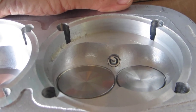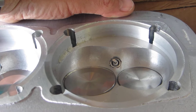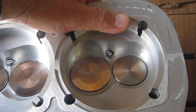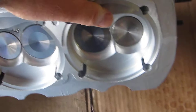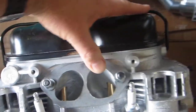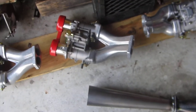The fly-cut should bring the combustion chambers to about 52cc. I'm going to measure that with a burette — you fill it with liquid, drip it into the chamber, and it reads off the cc's. That also explains why the IDF manifold was welded: so it could be port-matched to that head.